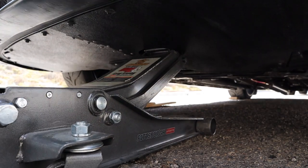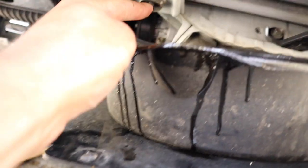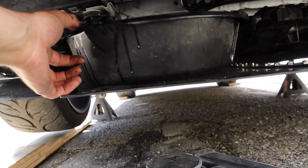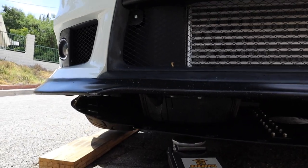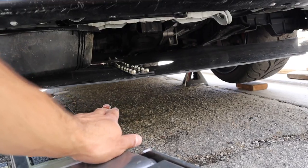I just checked my email and the autocross event I was supposed to go to Saturday with the 10th gen Si got cancelled, so I guess that gives me more time to prep the EG for the August event. To drain the OEM radiator, I need to loosen the petcock on the factory radiator — it's just a little nut you twist off by hand. I don't want to pull my splitter or under tray, so I'm putting a drain pan underneath and jacking the splitter up to support the weight as the coolant drains.